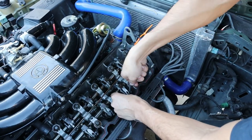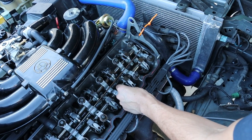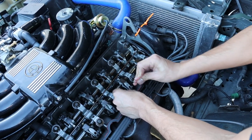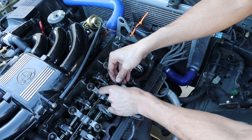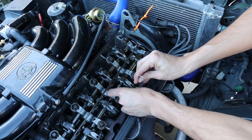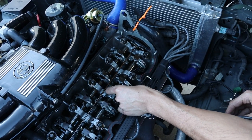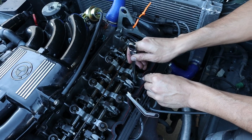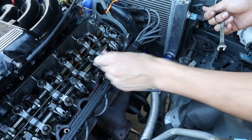So you go ahead and loosen that 10 mil — just loose, it doesn't have to come off or anything, just loosen the 10 mil. If your feeler gauge is still in there, get on here and you can move this eccentric back and forth as much as you want. All that's doing is changing that little value. Once I bend it all the way this way, look at that — ton of room. But I can tighten it back down and get it right at that perfect little resistance so that it barely goes in and out. With that there, you tighten down your nut and hold the eccentric in the other way. Adjust it. You do that 12 times and you're good to go.